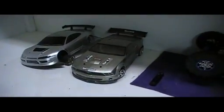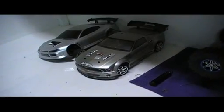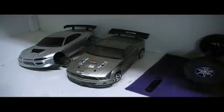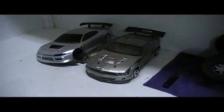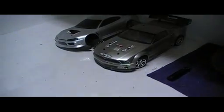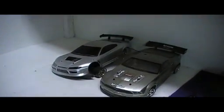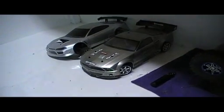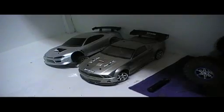If you want to do some high-speed racing on pavement, you definitely want the brushless system and make sure you get a really good set of touring tires. Soft compound I would not really recommend because they wear out extremely fast. Hard compound I would not recommend either because they would not grip well enough and you'd probably slide more because it would end up being like a drift tire. So if you could find about a medium compound tire, that'd be awesome. I have to order a new set for mine anyway since they're completely racing slicked out — it'll just sit there and do donuts.